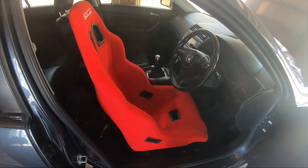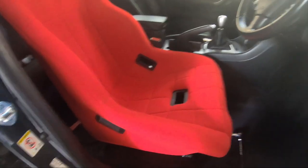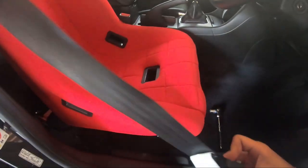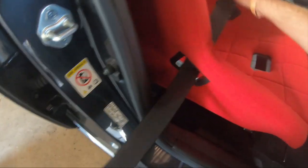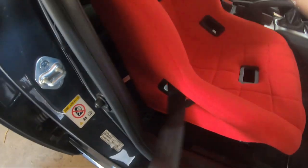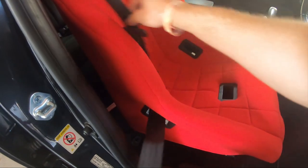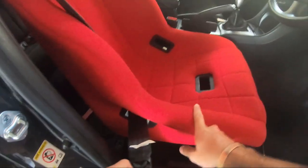Now you've got yourself your seat belt — it's a hell of a lot lighter putting that in than taking the other one out. Then it's just a case of lining your bolt holes up. Down here your lower seat belt mount you need to unbolt — it's a 14mm — because this part is meant to be a lap sash, so you need to put it through your lap hole when you put your seat belt on so it clips on nice and snug. The adjuster comes in too because you might need to lower your seat belt point — now you've got lower seats, lower seat belt point.